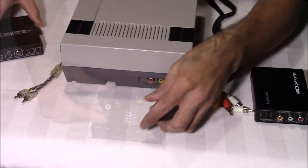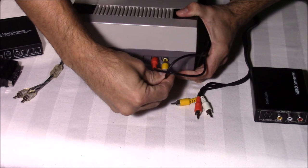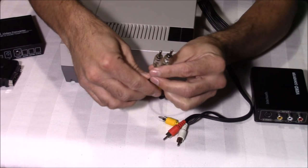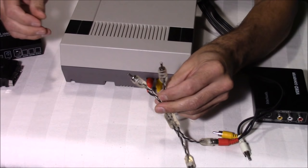You're going to want to use a pair of composite cables — that's your red, white, and yellow cables. On the Nintendo you'll notice you only have a red output and a yellow output, so one video output and one audio output. Optionally, you can use a splitter on that red audio cable to turn that into two channels. This will not be true stereo sound — it's mono separated into two channels — but it will still work. I have surround sound speakers hooked up to my TV and if I only have sound hooked up to one channel it sounds very weird, so I like it a lot more with sound coming through both channels.